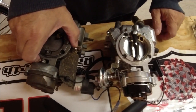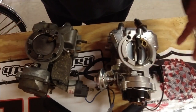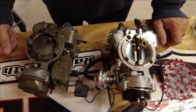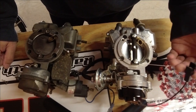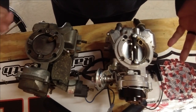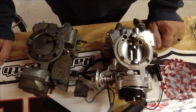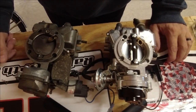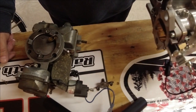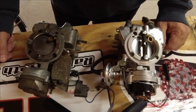Let's compare the two carbs. The OEM Carter is way heavier — this new one is way lighter. I'm not sure if it's because the new one is aluminum versus cast iron, or just because it's from China. The Carter has definitely got more weight to it and handles some things a bit differently. The choke has the same connection, and they supply the connector in the box, which is nice. Everything else looks pretty much the same. The amount of rust that dumped out when I pulled the fuel line is scary — that's either rust in the tank, in the line, or both. That may be what happened to my Carter. I'm going to put an additional inline clear plastic filter to capture that so I can see what's going on.